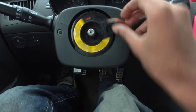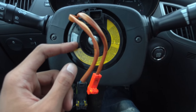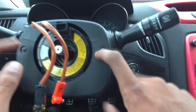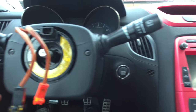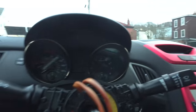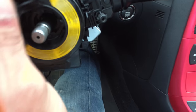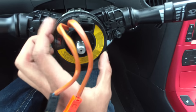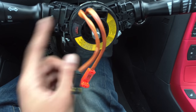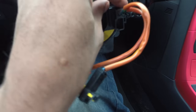The steering wheel is officially off. Basically all we have to work with here — since we're not going to be using this — we do have to take this off. I'm not entirely sure how to get it off, so hopefully I don't completely destroy it. There are two Phillips head screws; I'll get those off and see how it's supposed to come apart. Once I get the shroud off I can see the housing for the turn signals and windshield wipers — it's all in there, and there's a big cable inside that I've seen someone unwind by accident, so I'm going to attempt to avoid that.